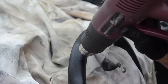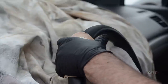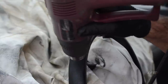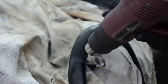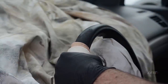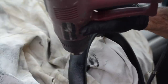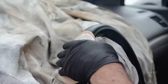Now, in my opinion, a grain pad should be large so that the edges can float freely without affecting the surface. Also, I'd suggest making your own grain pads so that the edges remain rounded. The purchased grain pads are often cut square to look nice, but the sharp edges will leave lines in your work. If you'll notice, I'm applying pressure with the palm of my hand, and then my fingers are wrapping around the cooler portions so that I don't leave an imprint.